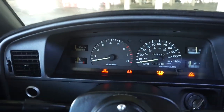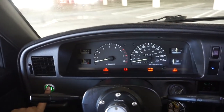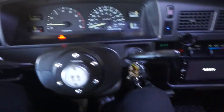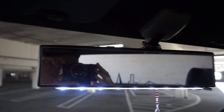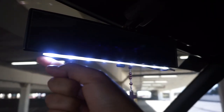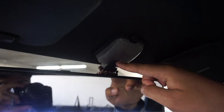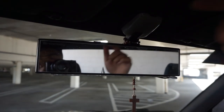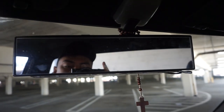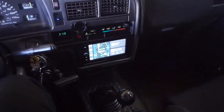So we put it in the on position and hit engine start — there she goes. Put it in neutral, all looks good, brake light goes away when you take the brake off. Moving on to the rearview mirror — I wired an LED strip I got at O'Reilly back here and got rid of the dome light because it wasn't bright at all even after doing the LED upgrade. It triggers from the door — turns on when you open it, turns off when you close it, or you can set it to always on.